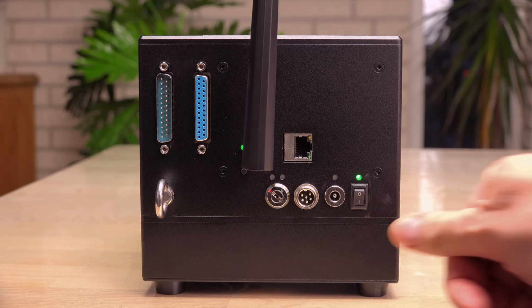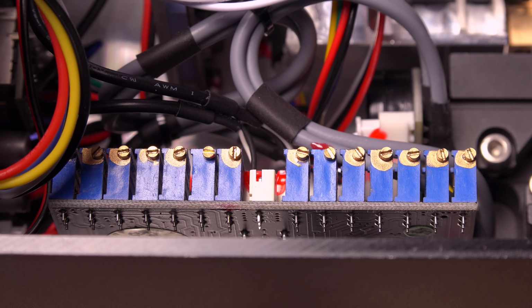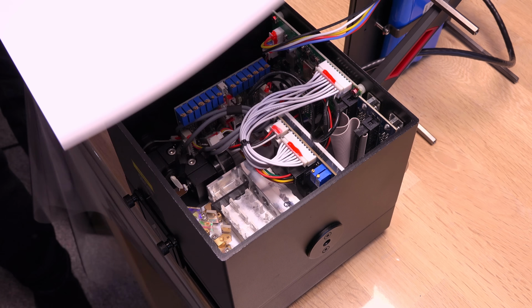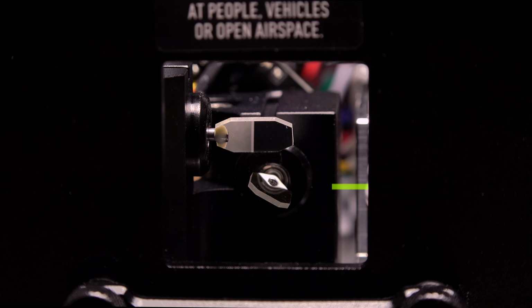Well, do not turn on an open show laser. It is not safe. As a precaution, to find out where I could place my camera safely, I tested for beam leakages with a paper lid first. Okay, it is mostly over the galvo mirrors. Expected, since the beams are supposed to travel horizontally until they hit the x-axis galvo. This will send the beam vertically up onto the y-axis galvo.